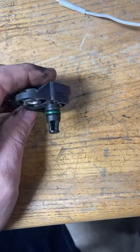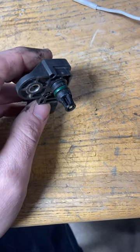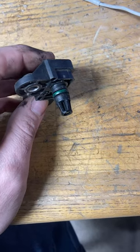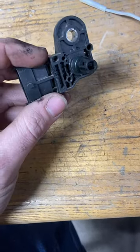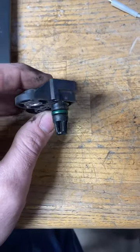Now removing them is super easy — you pull the black engine cover off, you pull the piece of foam off, and then it's like a T30 or T35 Torx bit to take this off, and then you just unclip it. So it's not really something that you need a detailed video to show how to do.